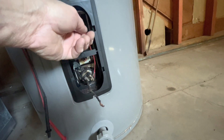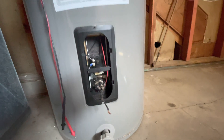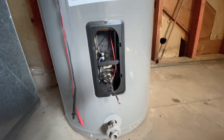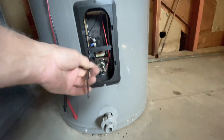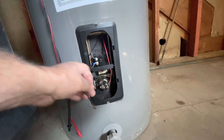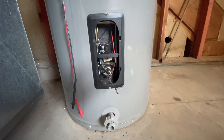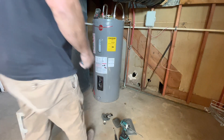I don't know if this is bad — the heating element. I almost think it isn't, so I'm going to test it right now. We'll test it with the ohm meter and see if it's good. I have a feeling it's good and I would just have to replace the lead. If it was loose and arcing, it's going to heat the wire up, melt the sheathing, and then all bets are off. So let me mount this back up and test it.